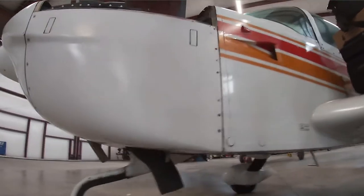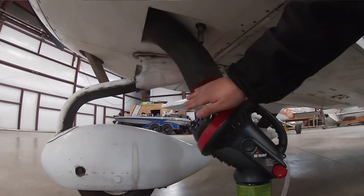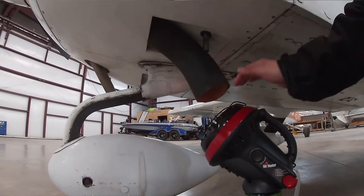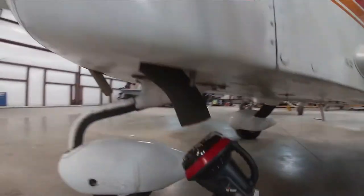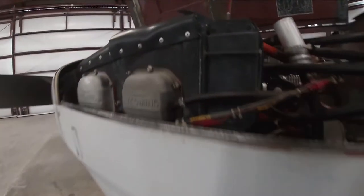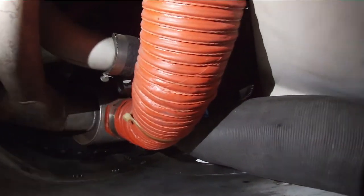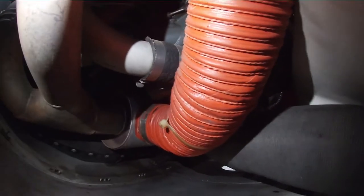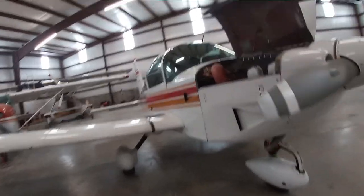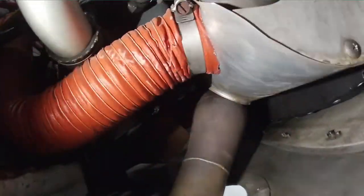I got the tube in. All I'm going to do is put the Mr. Heater right here below it — that's it, nothing's touching, nice little space. It's warm but not too warm. Let me show you a quick little disclaimer — this is the Lopresti modification. I'm cheating a bit. There's a duct right there underneath the sump, positioned right where it needs to be, and you can see where it's exiting on the other side.